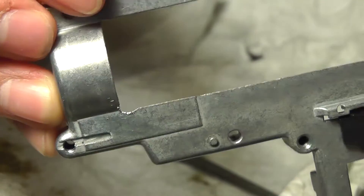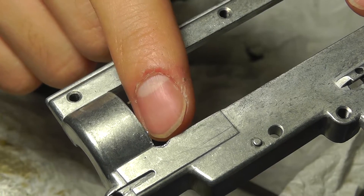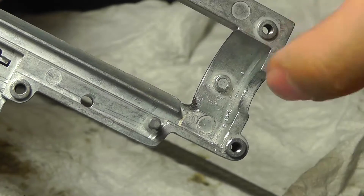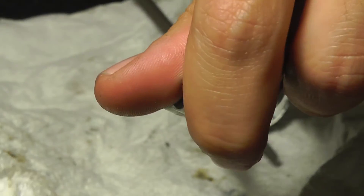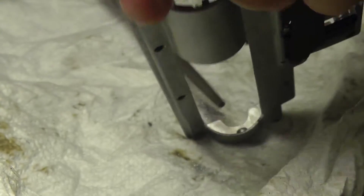So if you see right here, you can sort of see that little divot now. Some people make the mistake of just trying to recreate that divot, and that's not what you're trying to do. You're trying to radius off this part so that the impact becomes less on the front end of your gearbox.